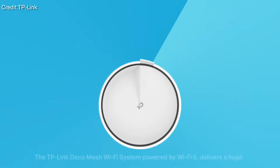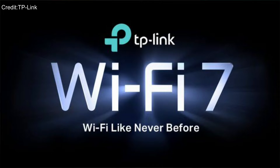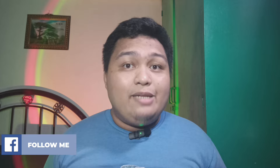Wi-Fi 6 is a not-so-new Wi-Fi standard now that gives almost 3 times the speed of what Wi-Fi 5 is offering. At the time of this recording, the much newer Wi-Fi standards are Wi-Fi 7 and 6E, but that's for another video. Wi-Fi 6, or 802.11ax, uses the 5 GHz band that Wi-Fi 5 or 802.11ac uses too. From the maximum of 3.5 gigabits per second that Wi-Fi 5 offers, Wi-Fi 6 gives much faster speeds up to 9.6 gigabits per second. But just a quick note — the numbers I provided are theoretical speeds only, and it will still depend on your internet plan.